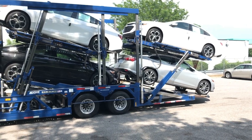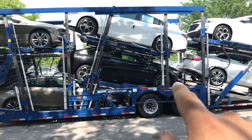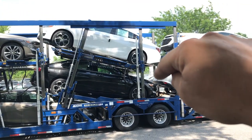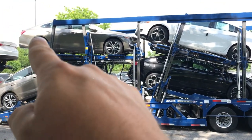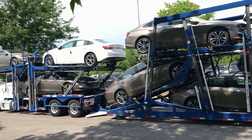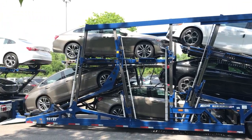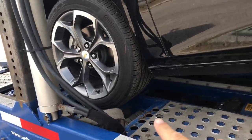My adjustment for my next load like this is to leave this one a little further out and this one a little further in, which would have gotten these right here to come down a little more and drop lower — leave the front up a little higher. This one I would have brought down in this area and left the back a little higher. We learn a little bit every load. This is the 10-car load walkthrough — I hope that helped. If you have any questions let me know, I'll do my best to answer in the comments. Please like and subscribe.